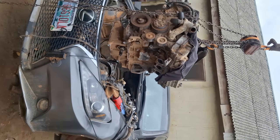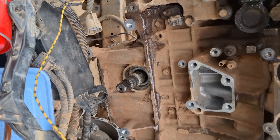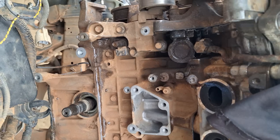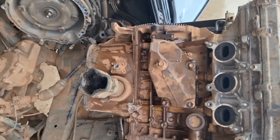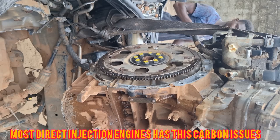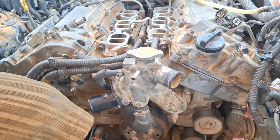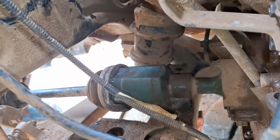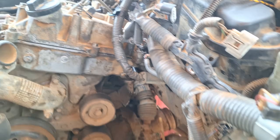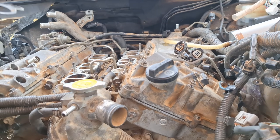We are done assembling — I'm about to get it back into the car now. It's been sharply assembled. All the valves have already been cleaned, all the inlet valves have already been cleaned from carbon buildup, which is common with all IS250s. This is the progress so far — we've installed the engine inside and mounted the axle. I've filled it with new axle oil and we are now installing the shafts, left and right. We're also installing the CV boots on the driveshafts.